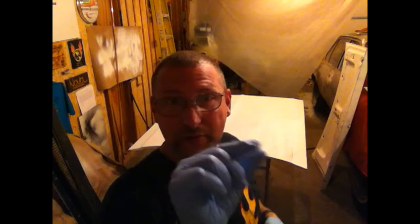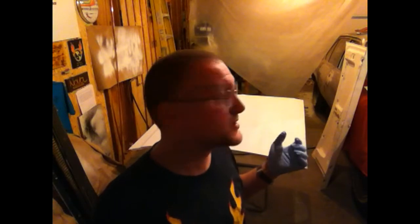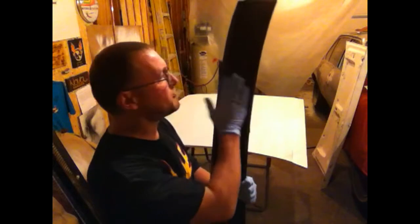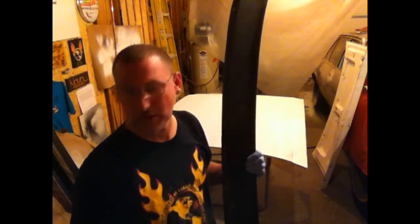This car has been in bare metal, or huge chunks of it have been in bare metal for 6 months, give or take. And just a little spot of rust here, a little spot of rust there. When I see a spot of rust, I'll blast it with phosphoric acid and then sand the excess off, and that's it. It doesn't rust. But maybe a big part of that is I'm careful not to touch the bare metal, and if I have to move parts, like even the deck lid and the hood around, or cowl and trunk pieces, gloves. Gloves only.